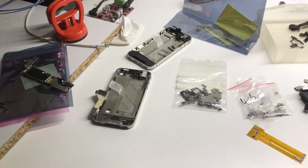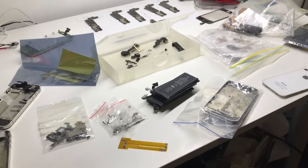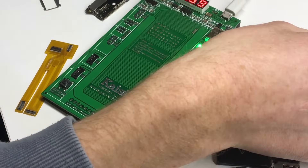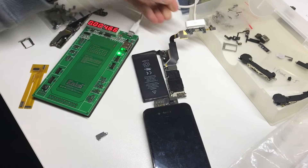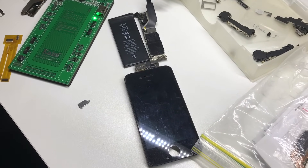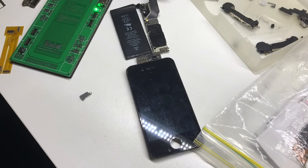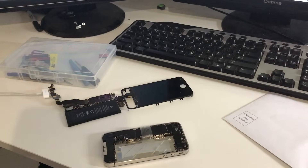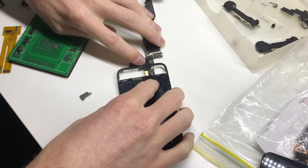So I've gotten a lot of iPhone parts which I'm going to be putting to use. The first logic board we're going to be testing is one of the ones that came with the parts we just looked at, along with one of the screens. It doesn't power on or do anything. Plugging it into iTunes, you can see it shows up and is running iOS 6.1.3 — it's a 16GB white iPhone. I'm pretty sure this one has long screw damage, where someone put the wrong screw in and damaged a trace on the logic board, which is why the display isn't working anymore.